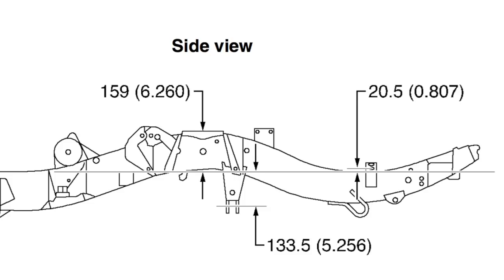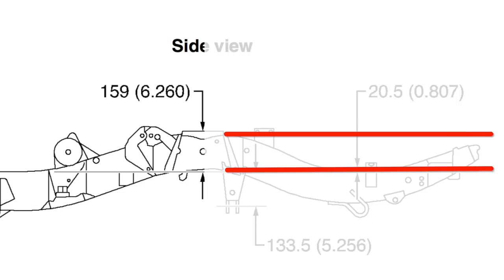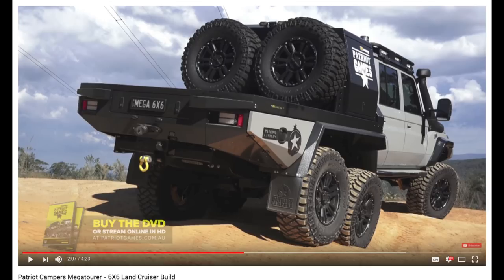With the plans, you can see the side view on the end — there's a curvature which dips down. This is just to assist with fitting the body and protecting the tank, possibly. You can see where the spring hanger is. If you cut off this piece of the chassis on the rear end, it can then have a straight extension put onto it, which obviously has got to match the same characteristics of how the chassis was made. I don't want to bobtail this — you can see the type of flatbed that we could put on it.